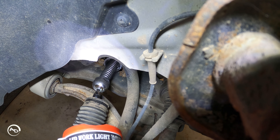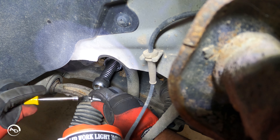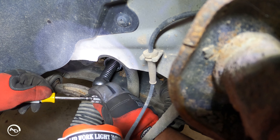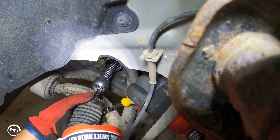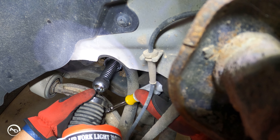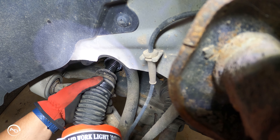I'll sit here and get that hose clamp on there — I've got the crimping tool already. Started just to make it easier once we get into that tight spot. You could go out and buy one. It's a very comparable crimp to — if you've ever done PEX tubing — basically a crimp just like that, except on a smaller, thinner scale. Obviously it's not holding water pressure, it's just holding a boot on.